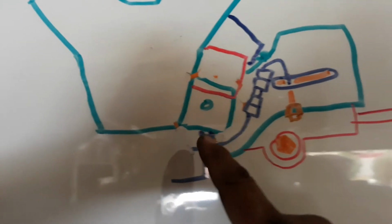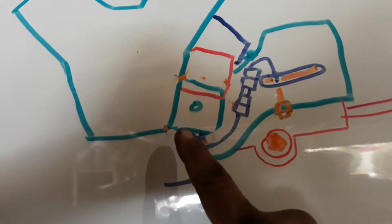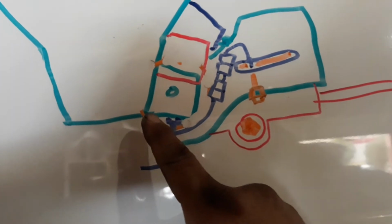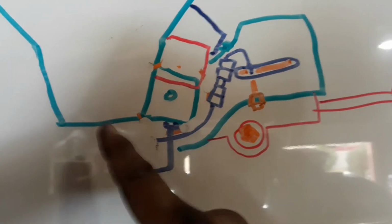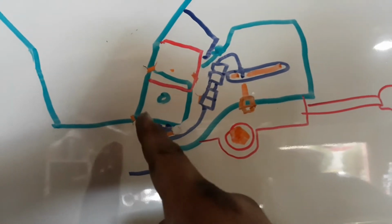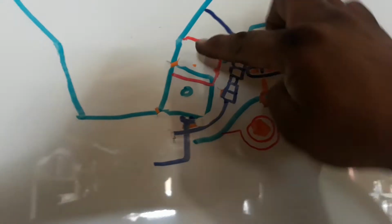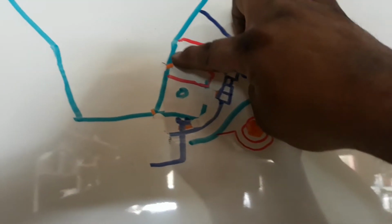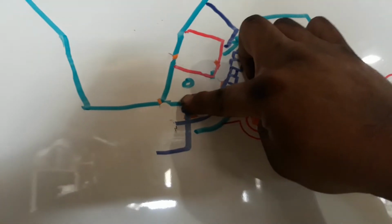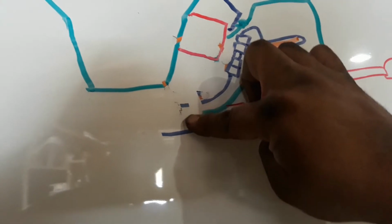This is not an accurate drawing, but the line is right next to the 10 millimeter one here. It's just far away to get it in between the bolts so that you can crack it loose. But as you're loosening it, the power steering unit drops away from the engine. So I'm trying to show you. So we got this out and this portion of the line out.